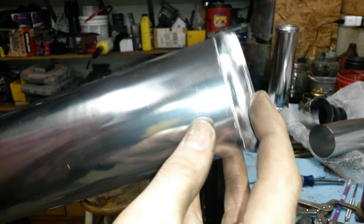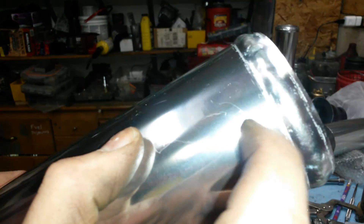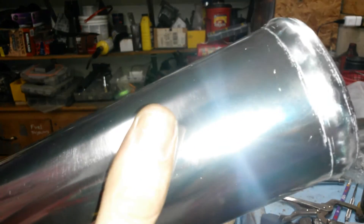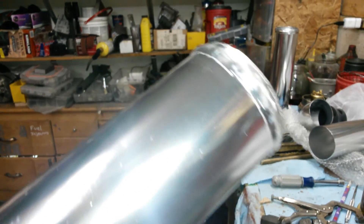You see this real groove right here — I didn't bevel the edge of the inside of that exhaust clamp. You should probably do that so you won't get a little bit of cutting there. But it's not an issue for me because it's covered by a coupling anyway. So, well, there it is. Thanks, have a good one.